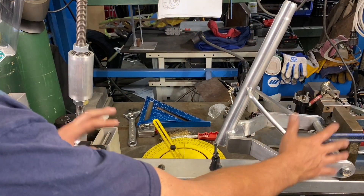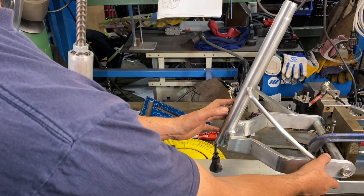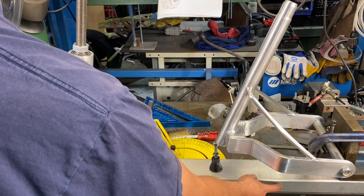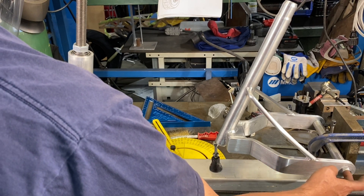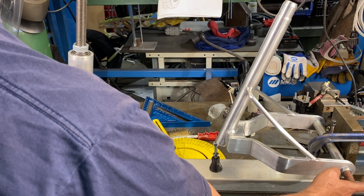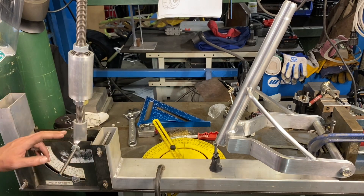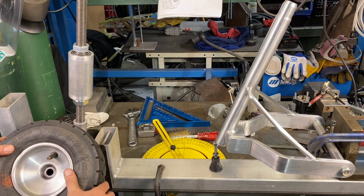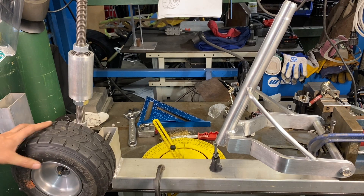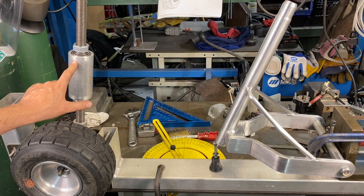To tie in the rear with the front end, I first squared up the back end with the outside of the frame rail and made sure that the bottom pivot — the back pivot — is the same height as the front. It's about six inches to the bottom here, and six inches to the bottom there. You can also put the tire in, and this is the pivot for the front end.